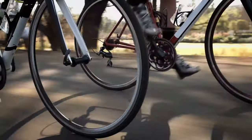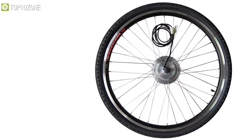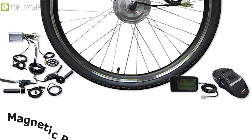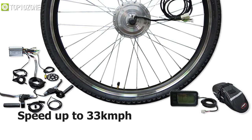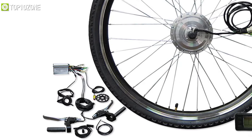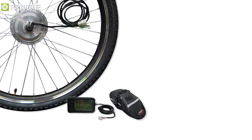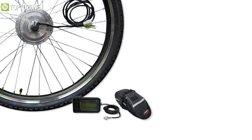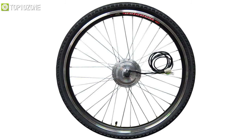Looking for an ideal combination of speed, power, and competitive pricing? Then check out the Mod Wheel, a front wheel 26-inch e-bike conversion kit offering the best overall value for money. With a magnetic pedelec option, it includes a geared 36V 500W electric motor offering speeds up to 33 kilometers per hour. The pedelec is managed via a lightweight controller that also includes a thumb throttle for smooth and instantaneous acceleration. Unlike direct-drive motors, this kit is great for hills and inclines and cruises downhill without drag. It also sports an LCD speedometer, an electronic controller, and a carry-bag to store the controller, combining modern e-bike technology with affordable pricing.